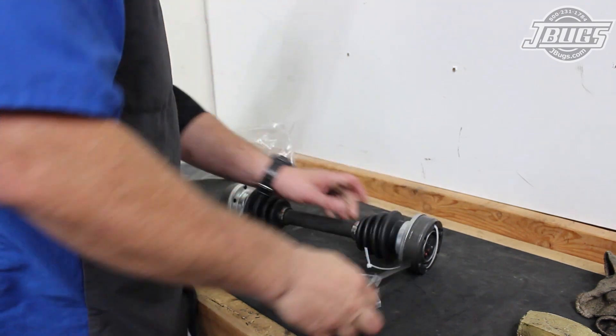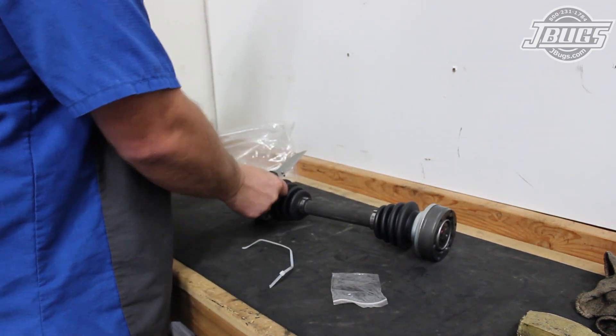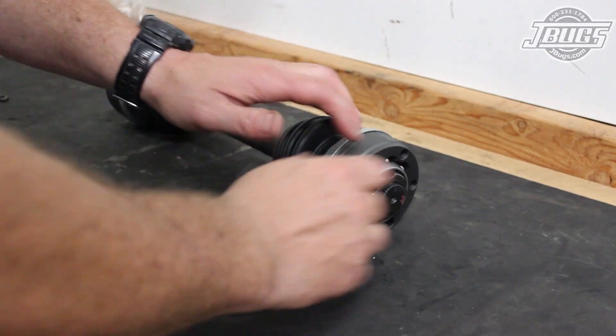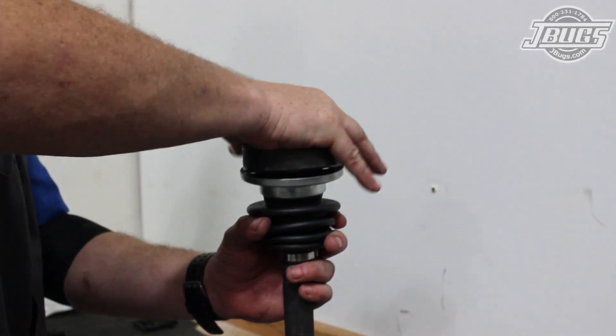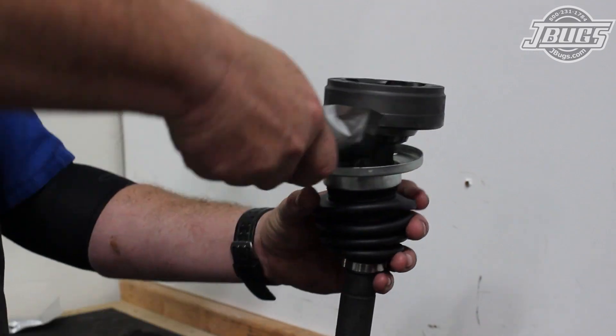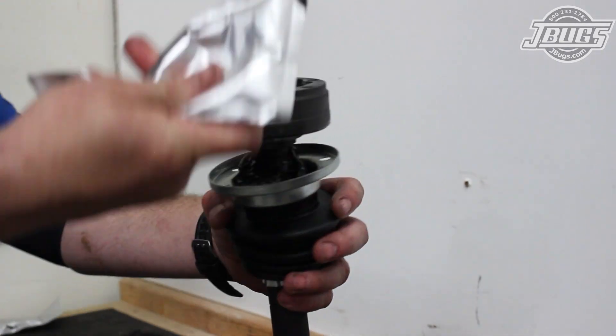We have a few more things to do before we set the body in place, and we start the workbench with the drive axle assembly. The half shafts come pre-assembled and partially packed with grease. We need to pack the joint fully, so we use a hammer and screwdriver to tap off the CV boot flange. Pulling back the boot, we can double check that the boot is packed. The axle assemblies include grease, and we squeeze some more into the boot and the rest goes into the outside edge of the CV joint.